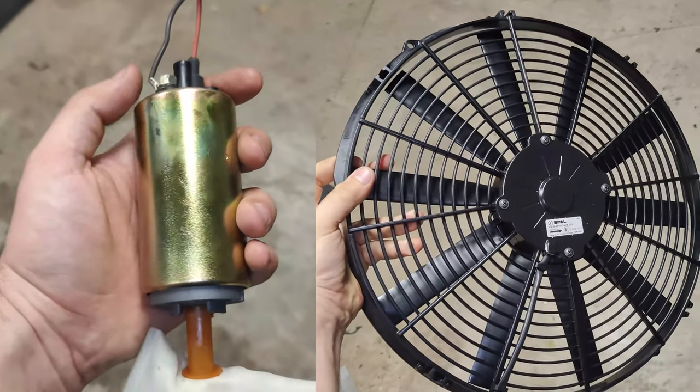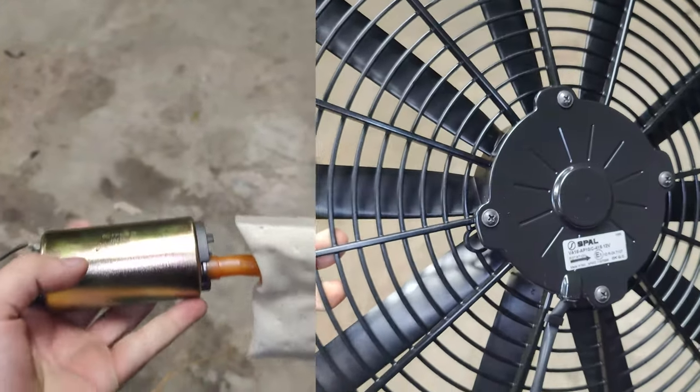The diagrams are the core of what I use to do my swaps. Mounting and bolting things in is pretty easy, honestly, but knowing how to read these diagrams and how to wire things up is what matters most. Our goal with doing a swap is to get the engine to run in a car it wasn't meant to be in, but also have most everything remain functional. There's more to it than just wiring the engine — we also need to get things on the body to run, like the fuel pump and the radiator fans. You could pull new wiring for each of these, but why would you do that when there's literally better wiring in place ready to be used? We're not barbarians — just read the diagrams. So, now you know how to read a wiring diagram — how can we actually apply this? Let's start with the core of everything: the ECU.